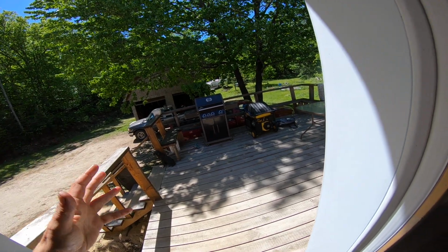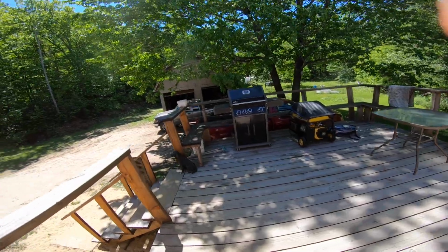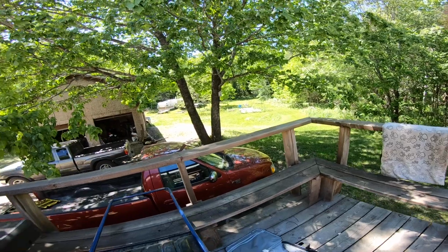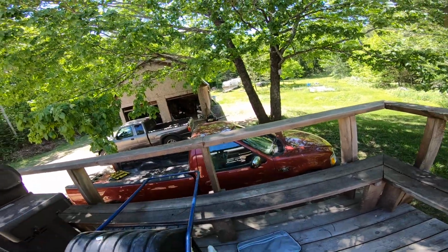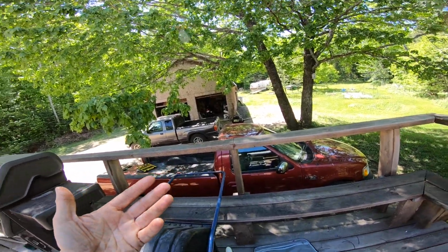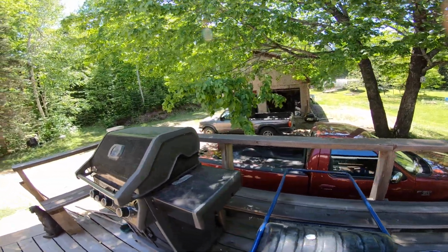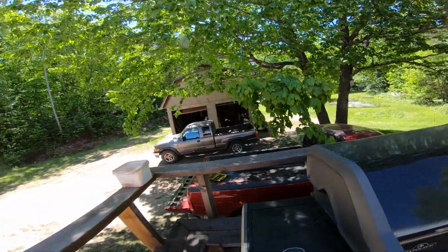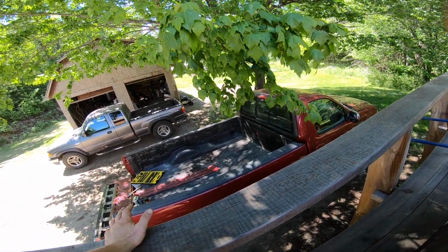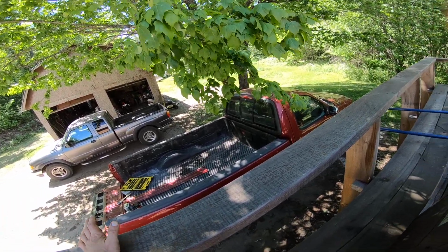Now, for those of you who have gravel guard, can you do this over gravel guard? That's the rubbery stuff. I would. I don't know if you're supposed to or not. The problem with the gravel guard is that if water gets in between the gravel guard and your steel, you've got water sitting there. Think of the gravel guard like the bed liner, you know what I mean? It's impervious until something gets behind it, and then that rusts you out. But most vehicles come with a gravel guard on it to begin with, and I would oil spray over that every year. Just myself, but that's me.